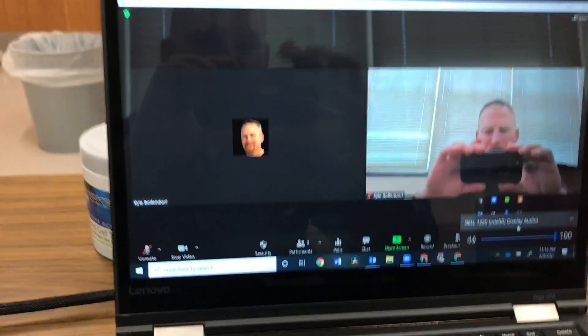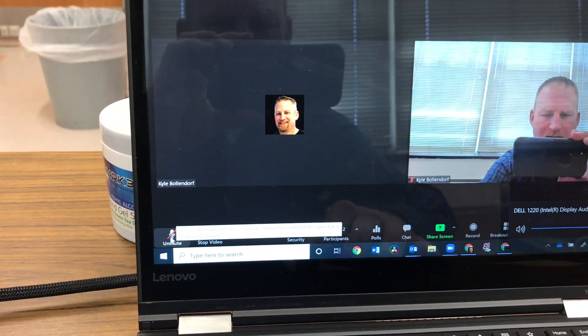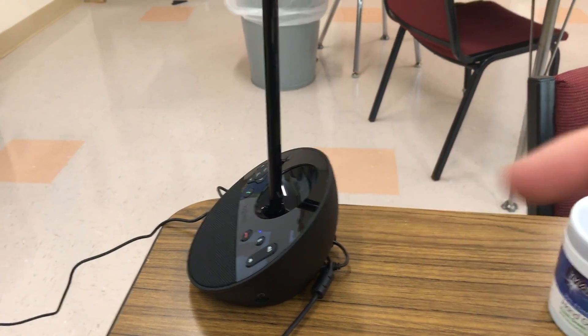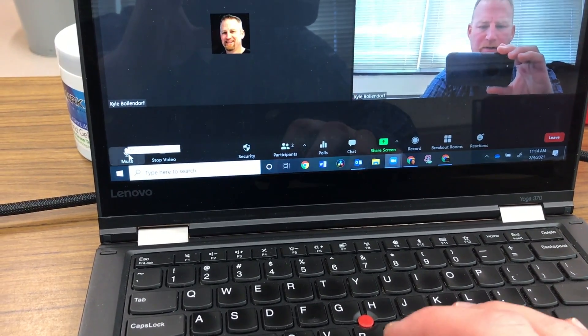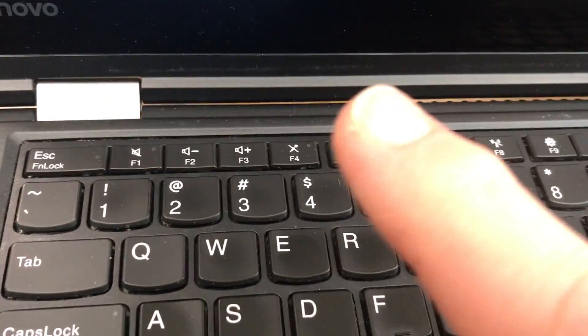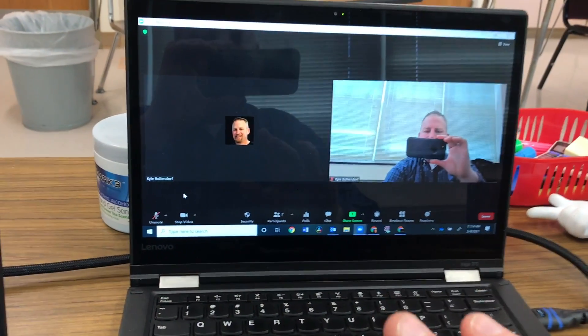As long as you have this microphone off here — let's turn it on and see if we get feedback. Now I'm hearing some feedback and echo through this speaker. To avoid that, I just turn this off and mute the microphone. Notice that I don't have the speakers muted — I only have to mute the microphone here.